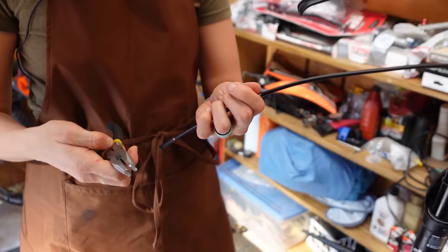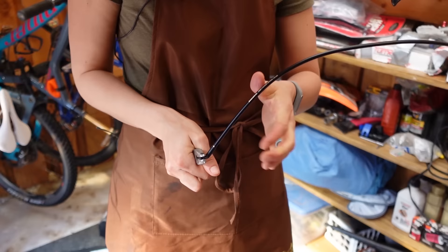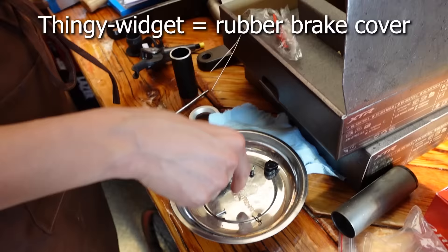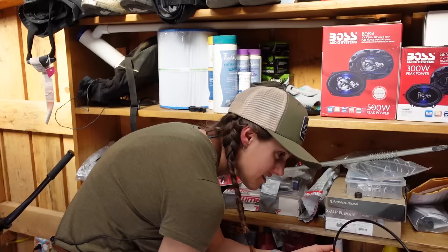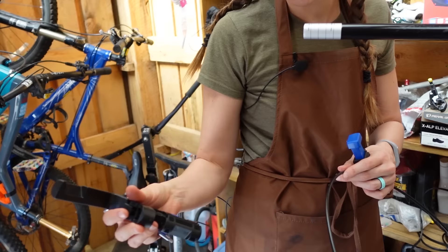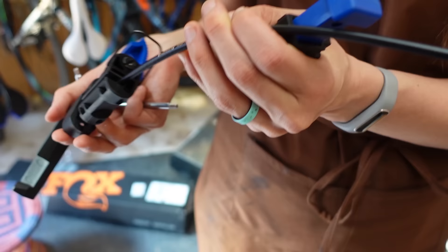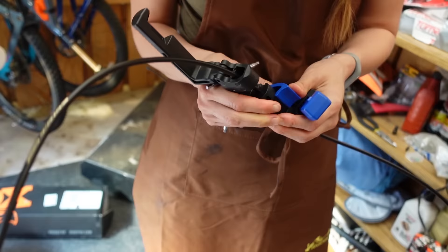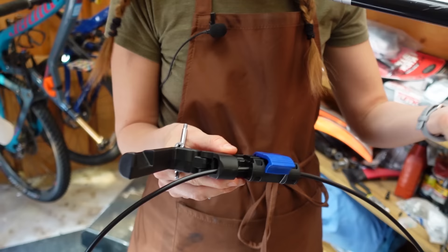So as you'll see, this has a barb on it — that's why it came in the bag with a second barb, or plug. So that's actually a plug and you're always going to cut at least that amount off — there's a mark here. We're threading this widget on. Then we're going to cut. This is the Shimano brake cut tool — I don't know what it's officially called, but you do need one of these if you're going to be installing brakes. There's our yellow line — line up the yellow line with that notch. This locks it there, and this one isn't an exact science on the cut; we have some leeway both directions.